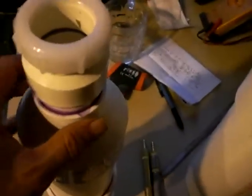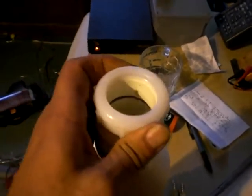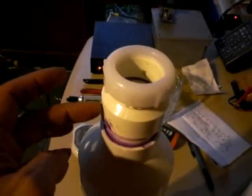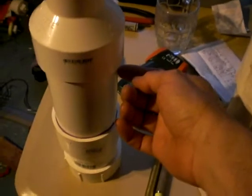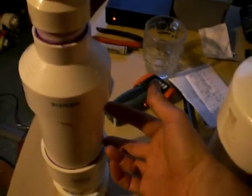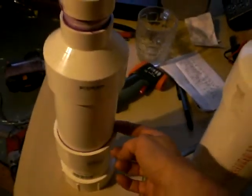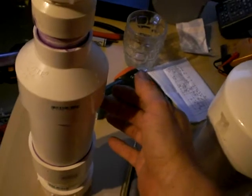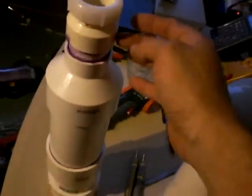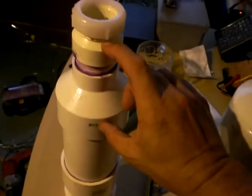The reservoir first stage bubbler is going to be the first pop-off. These caps right here are going to serve double purpose — they're going to be my blowout caps if I need them. There's going to be a blowout cap here. My gas is going to be coming out right about in here, and this will be the place where the gas goes out to the engine. My gas inlet coming in is going to be on the side, probably right about in here. The return line is probably going to be down at the bottom or on the side — I haven't quite worked that out yet. There will be a return line going back to the cell and an incoming line coming from the cell. There's going to be a gas line of some sort leaving the bubbler area, so this right in here will be where the HHO will be collected. There won't be any collected in the top of the cell.